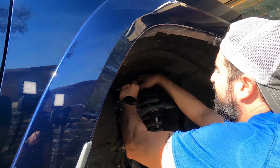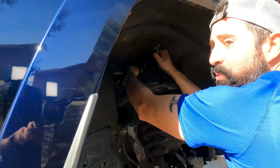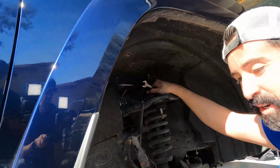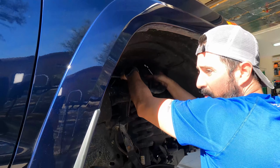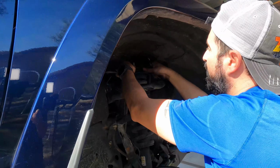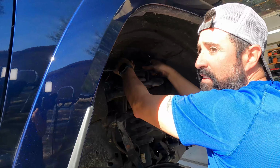Yes, they have. So I used to work for a tire company years and years ago, and part of the safety protocol was to stop working on split wheels. Split wheels had a special ring that got compressed to hold the tire together, and we had one come in, and we had a guy who was certified on them, and we went out to see how they get pulled apart. I swear to God, if you were bending over when that top ring came off on a split wheel, you would have lost your head.